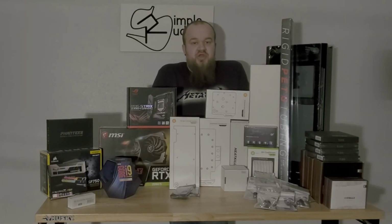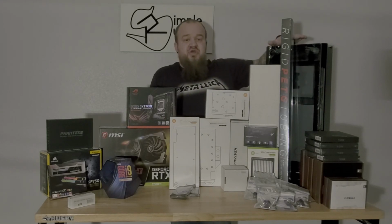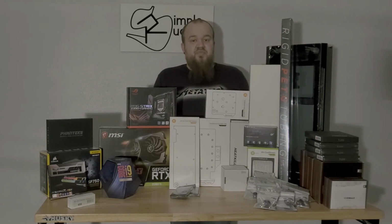Now with all the liquid cooling, I did not back down on the air side of it either. I went with Noctua's industrial grade 120s. I'll stuff 4 of them in the case. Phanteks does come with 2 140s. I am replacing the top 140 with the 120, so it'll match up with the radiator better. However, the bottom 140 I am replacing with an industrial Noctua 140 as well to get as much cooling as possible.